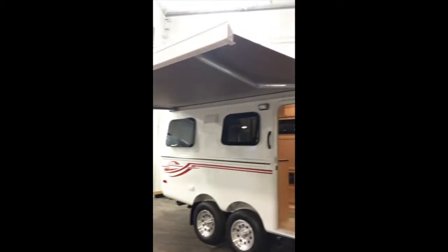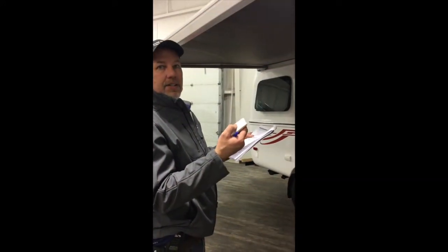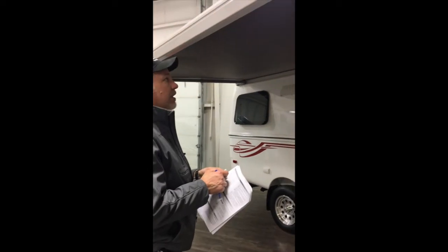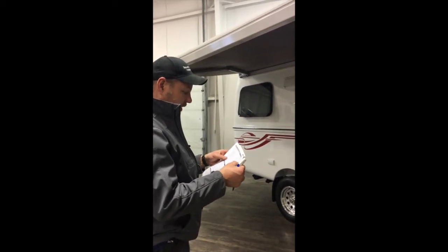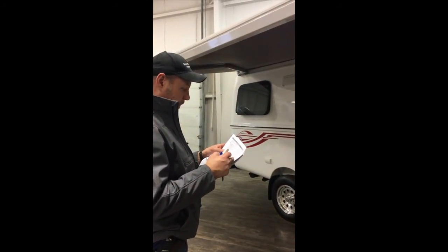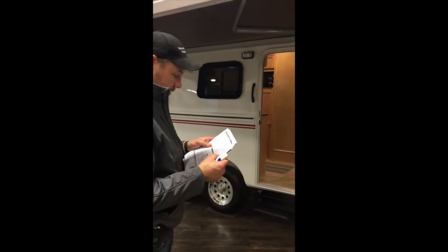I'm going to go there — it's really somewhere at that furthest out. Once you hold the out button down long enough, it keeps on going, so you have to hit the stop button once you get out that far. Press and hold the up arrow and the stop button until it begins to run. Use the stop button to stop it. Moving on to step 11: with the awning motor stopped, press and hold the stop button until it jogs. That's programming the out limit. Now step 12: press the button on the back until it jogs again.